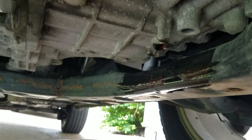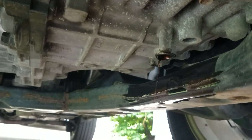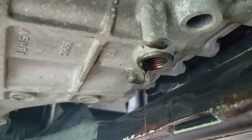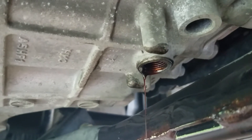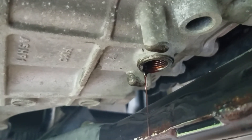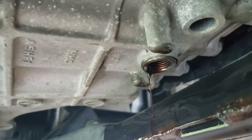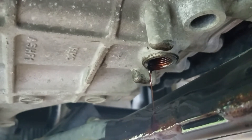As you can see, I've already started the draining. On the driver's side of the engine is the transmission and the drain plug right there. You can see it's got these two little nubs on each side of the drain plug. You can easily get in there with a wrench — a 15/16 will get in there and it's very easy to open. It takes hardly any pressure to crack that open and get it to drain.